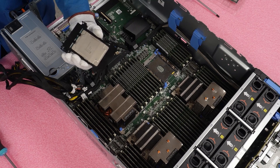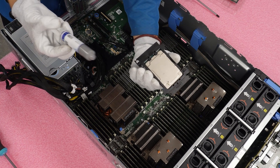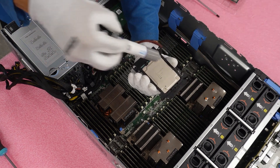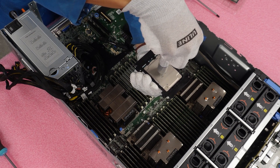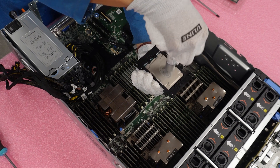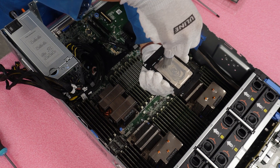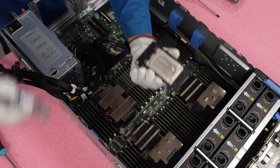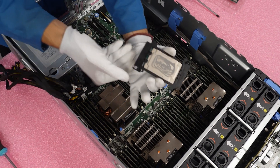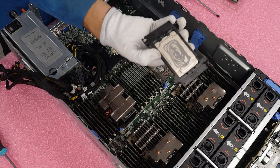Now apply the thermal paste — put it on top of your CPU. This is a point where there are some debates in the comments. Some say we don't put enough on, some say too much. I'm going to put a little bit extra this time because this system runs a little hotter than some older systems. But not so much that it flakes off the side or gets into the motherboard — you need a nice even spread.